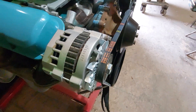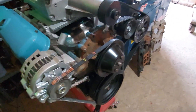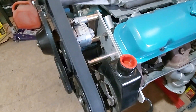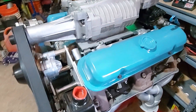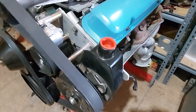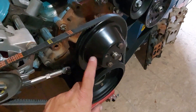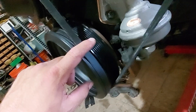The alternator is not original — that's from my Chevy pickup, like a '93-ish Chevy pickup. All these brackets on here are custom. I had to push everything as far back as I could so that the supercharger would go over the intake, which necessitated custom brackets rather than the original Pontiac brackets. None of these pulleys are original. The inner v-belt part is actually a Pontiac pulley, and the 8-rib outer part is from a Ford Lightning.